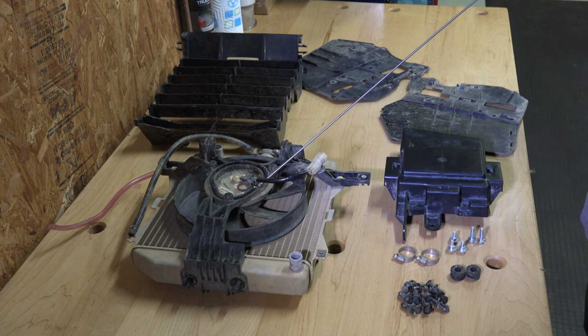Right here on this radiator, on this fan motor, there is this little nipple right here, and this length of red hose is attached there, and that's so that no water gets in your motor, but your motor can still breathe. And once you relocate your radiator, you're not going to need this long hose anymore. What you need to do is just cut a little bit of it off and leave a 2 or 3 inch piece on it, but you don't have to leave the whole section.